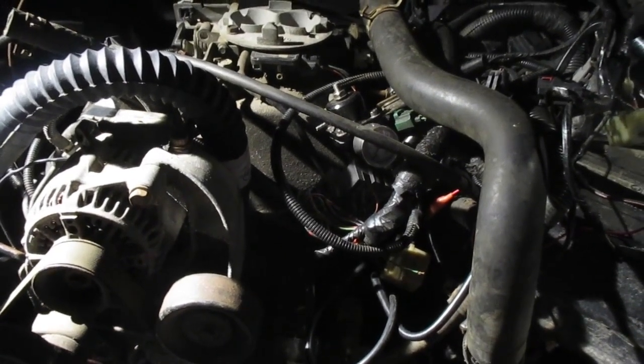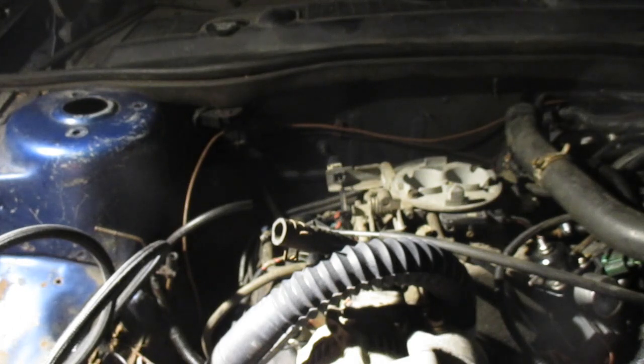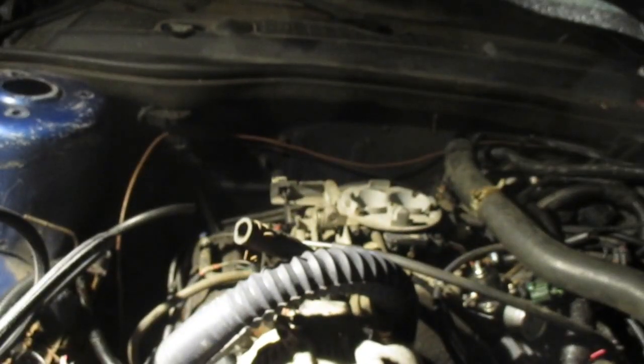I've got to put a longer negative battery cable on here, but I've got it — it's sitting up top of the car on the pile of stuff, getting ready to be installed. So that's about it: radiator in, everything else hooked up. I'll probably hook up a rudimentary electrical system so we may have some tail lights and whatnot. I'm also going to get a '97-and-up Dodge air cleaner boot to adapt the throttle body to a rectangular air cleaner, since the newer square ones should fit right in there. We'll find out if it's in the way and move stuff if needed.